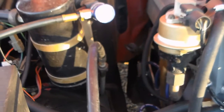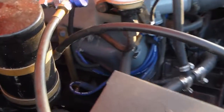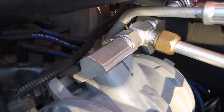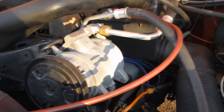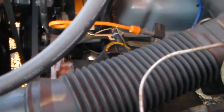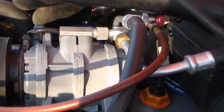What I'm going to do is replace the o-rings — probably not today since I don't have them. That one was in pretty bad shape and needs the manifold o-rings replaced too. After I do that, I think I'll go ahead and try it again. It would probably hold a charge because the rest of the system didn't really look bad to begin with.